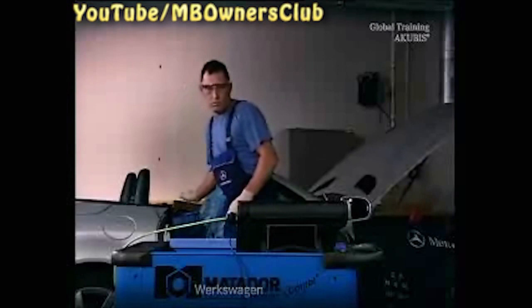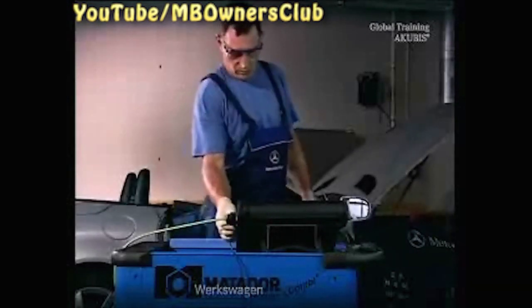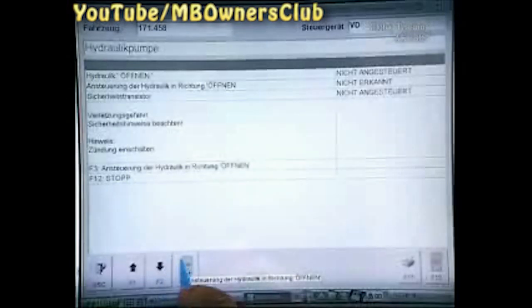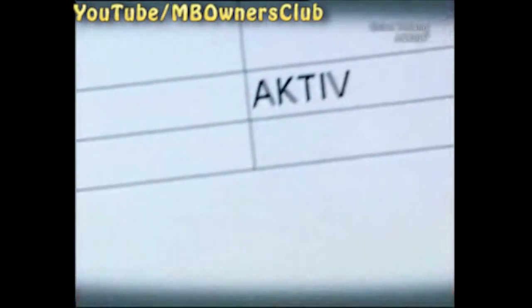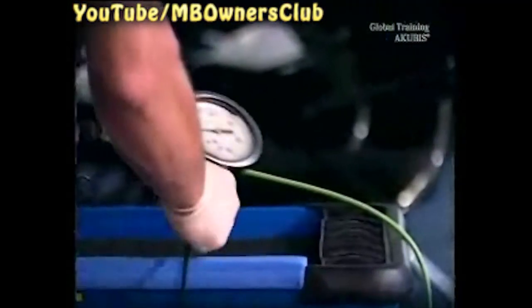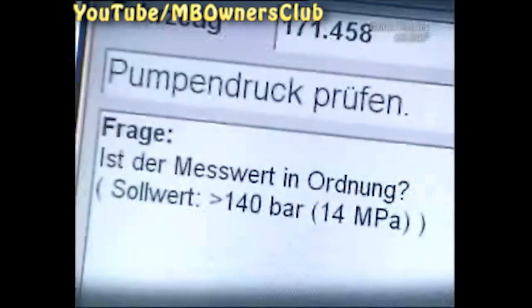You get the other connections from the VIS document on screen. Afterwards go back to Star Diagnosis and carry out a test run. In the test, check the pump pressure by holding the F3 button for 5 seconds. This way you can check that all connections have no hydraulic leaks. When no leaks appear, position the manometer so that you can read the test values.